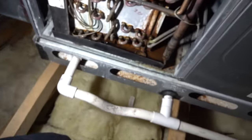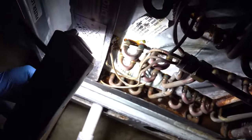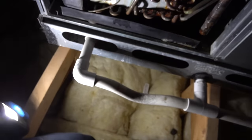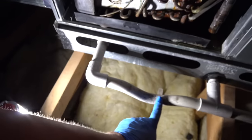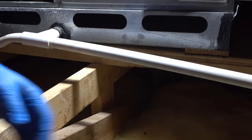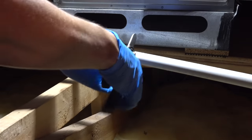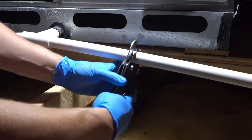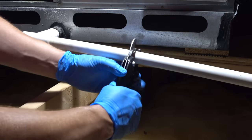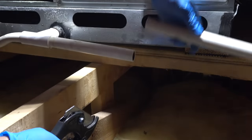With the door off, this whole thing looks complicated, but what you're looking for is right where my finger is — that's where the white pipe connects. That's the drain that carries water all the way outside. You can't easily get into that part directly, so I'm gonna go down the line about a foot and use my PVC pipe cutter to cut into the line so I can start working on it. This cutter makes it really easy, and because I used the vacuum there shouldn't be any water in the line, but you may still want to put a towel or bucket down.